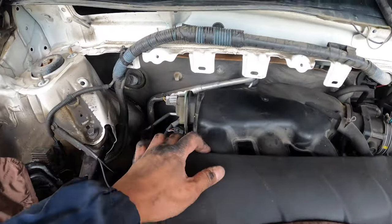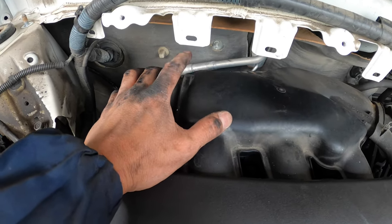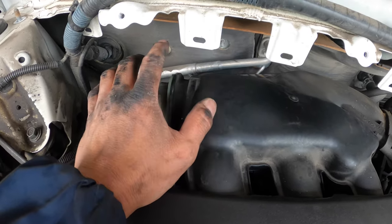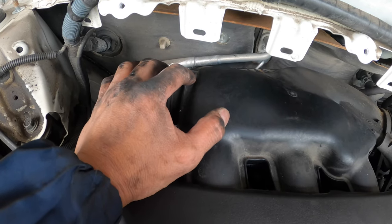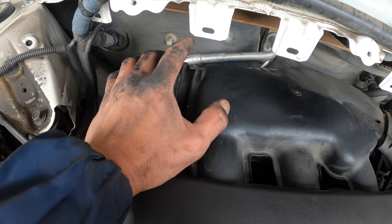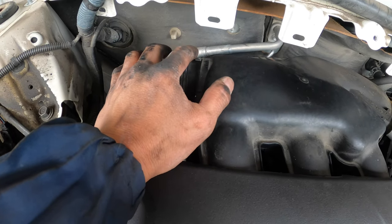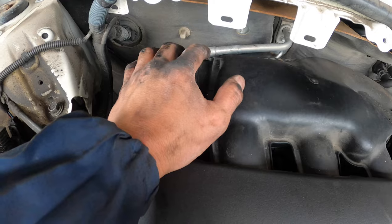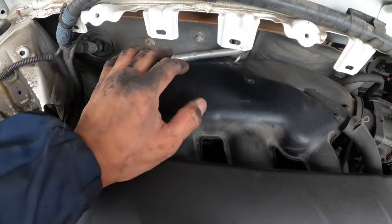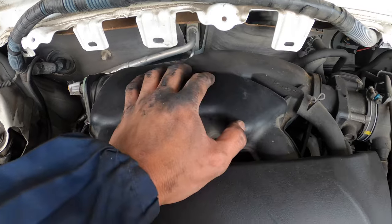All right, so I've got the spark plug installed, ignition coil installed, and the stay went back in as the reverse after removal. The torque for the spark plugs is 18 newton meter, the ignition coil bolt is 10 newton meter, and the stay is 21 newton meter, if you want to torque them to spec. Just FYI. So next I'm going to do the next two behind there again by feel, and see how it goes.